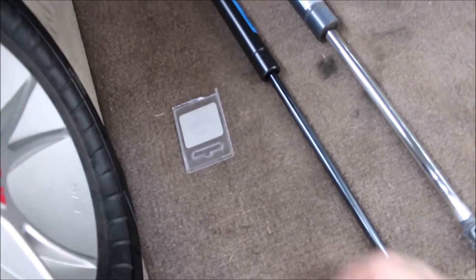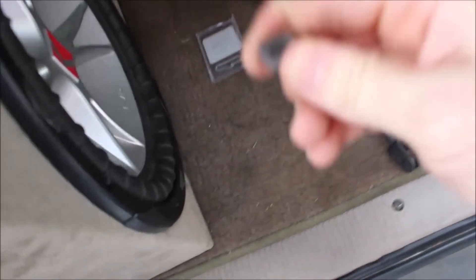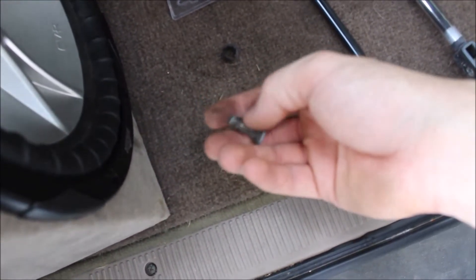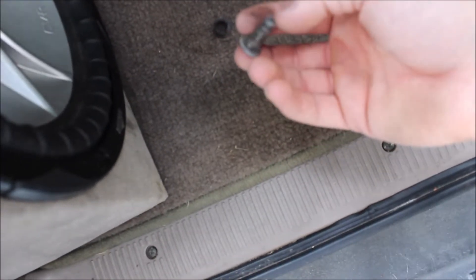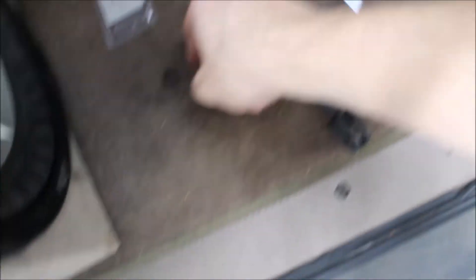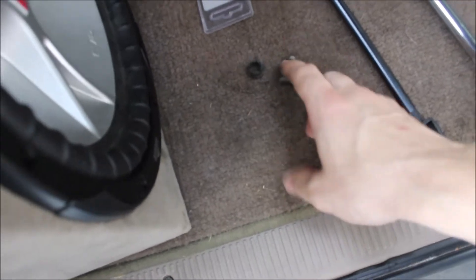It looks like there was a rubber bushing in here, but it actually disintegrated — looks like a piece of hard plastic now. So I'm going to see what I can do. It goes around the smaller bolt, so I'm thinking about putting a piece of vacuum hose I have laying around on there and lubing it up with some grease so that it doesn't bind. I'll show you what it looks like once I've got the piece on there.